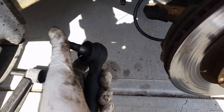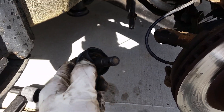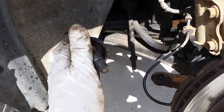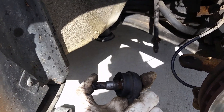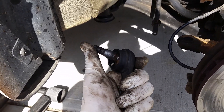So now you can see — look at this, this tie rod is bad. You see the play here, and actually this might even fall out. If it falls out, your car will go straight but one wheel will actually just go completely sideways because you won't have any control of the wheel and the direction of the wheel. You can tell it's bad because of the play here — it's very loose.